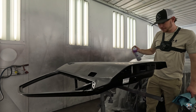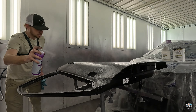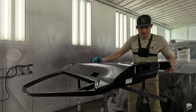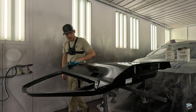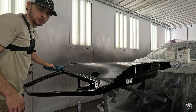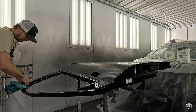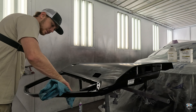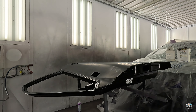Let's clean our door with our glass cleaner. This is one of the most important steps of painting anything, really, because if it's not clean, your paint might not stick very well and it might have problems down the road. Nobody wants a trashy, dusty, rough-looking paint job — we want it to look as much like glass as possible. This is a step that's kind of overlooked; everybody does it but nobody really talks about it.